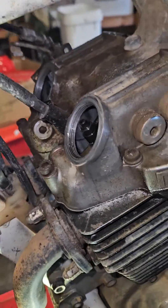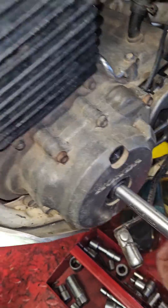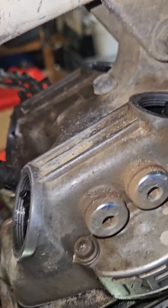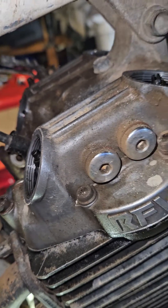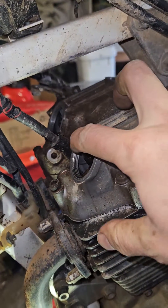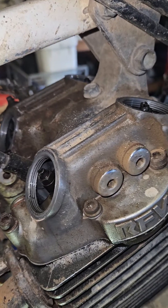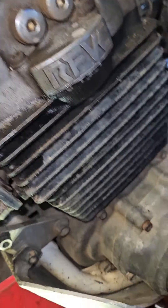So real quick, this is how you do valves. You turn the flywheel over counter-clockwise and you'll see these tappets go down, and you've got to find top dead centre on the compression stroke. The compression stroke is the stroke where all the valves are shut. The way to find that is you rock it back and forth — when the valves aren't moving anymore, the tappets, you know you're on the right stroke.